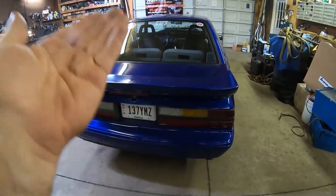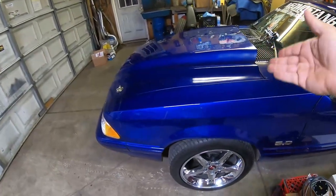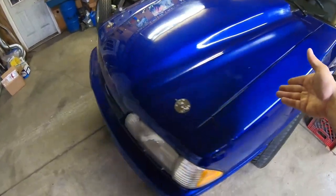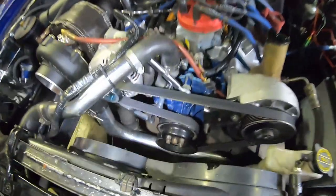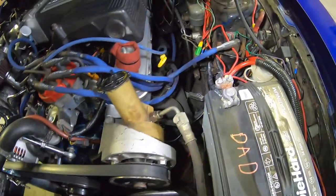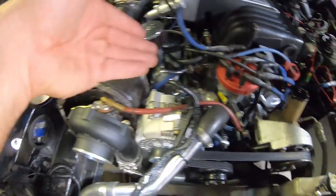I'm here to talk about what's next for dad's stock bottom end block and the tuning situation. As most of you guys know, we've been building on a GT40 stock bottom end motor. On a speed density car we've been very successful — we took an On3 kit, cut it up, and made our own turbo kit. We're currently using an old school Kenny Bell FMU to control the 19 pound injectors, and we recently made 351/405 to the wheels on 19 pound injectors on a Mustang dyno.